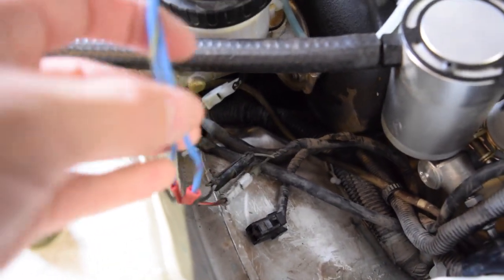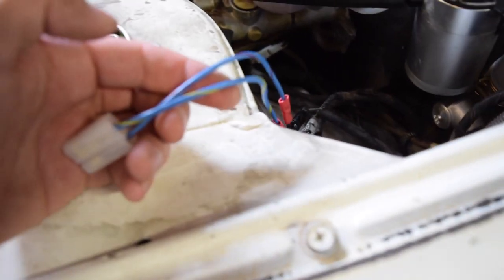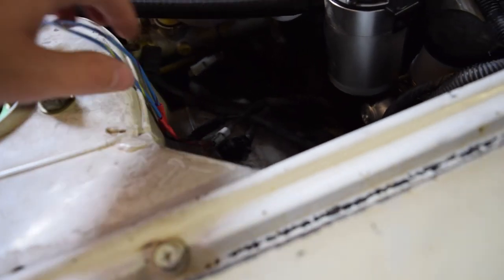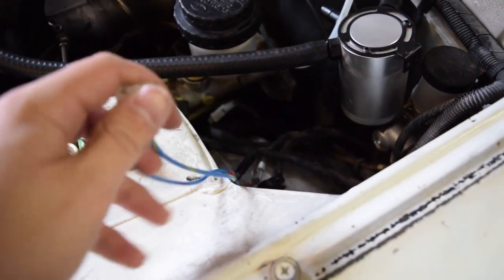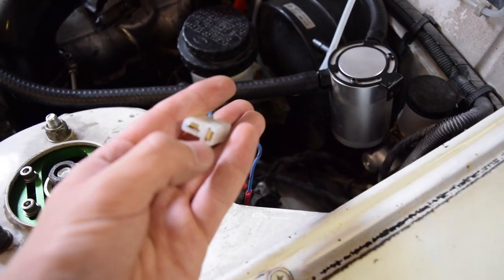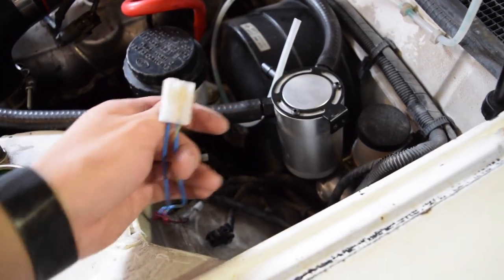I went ahead and got the wiring all sorted for the rear pump. On these new ones it didn't say which was positive and negative. With the old wires, black is always negative, so we have red positive and black negative. The new wire has yellow and red — I guessed red was negative and yellow was positive, and I left it loose first so I could switch them if needed. It ended up being correct. So the red positive goes to the yellow wire, which is the flat pin — whichever one is flat is positive, and the one standing up is negative. Now we can go ahead and stick these on the pumps and install it all.